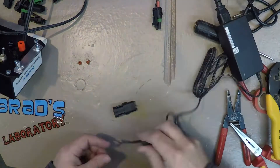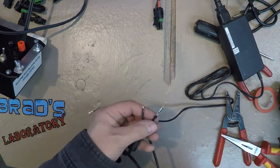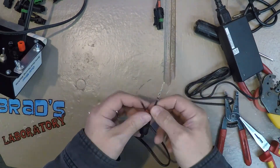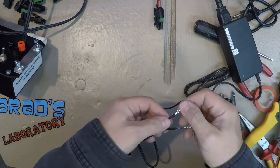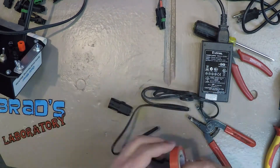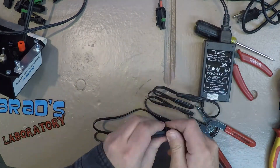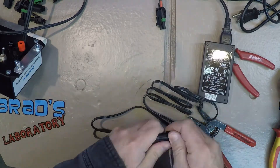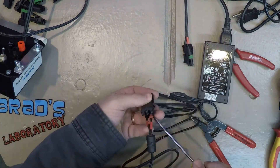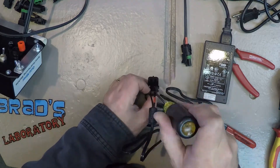On this side the little rubber grommets fit fine over the insulation, so I crimp those and do the other one too. I figure out which side is positive and mark it with red tape, then open up the connector — this one gave me a little trouble but I got it finally — and get the red going to red and black going to black. I had to tweak the pins a little bit, then it made up and I got it done.